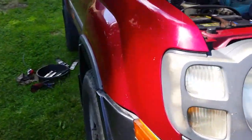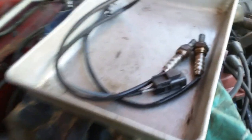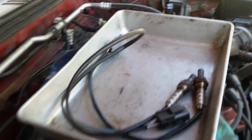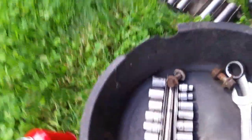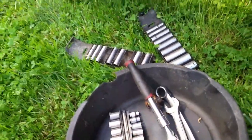I'm kind of shooting this on my cell phone, so I'll try not to be too jiggly. I've gone ahead and pulled out the O2 sensors — I have a video on that too. I could not get the old one out on the bottom; I destroyed it and used a special wrench I made. Here are the two new ones I took out — they were pretty easy. Here are the two bolts I took out of the crossmember. They had some grease on them and came out pretty good.